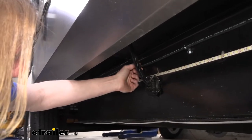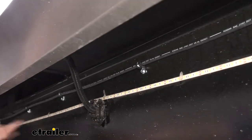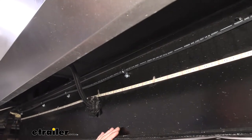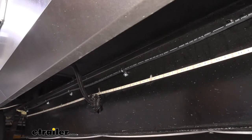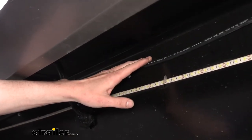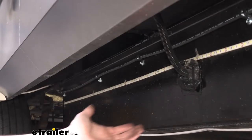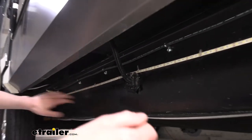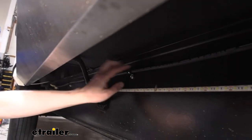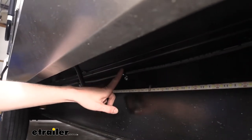This is what our flexible line kit looks like when installed. You get a 15-foot main line that goes all the way from the actuator back, plus a full tandem kit to branch out from the main line to each individual brake assembly. This is a fully flexible line kit, which makes installation significantly easier because you don't need additional tools such as a brake line bending tool. With hard line, you have to bend all your angles to route it front to back, which can be quite difficult. You do want to make sure you get good clamps - this rubber-covered clamp kit prevents digging into the flexible line.